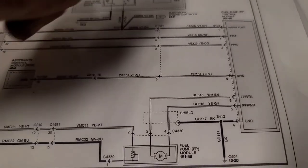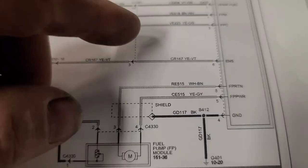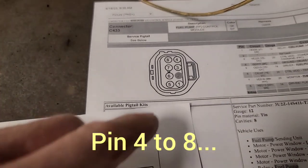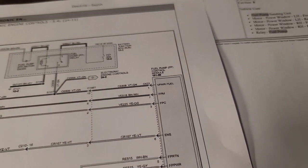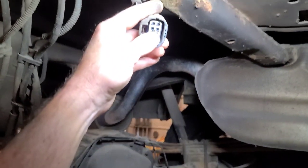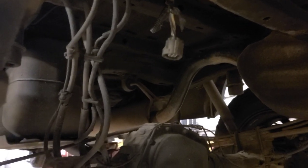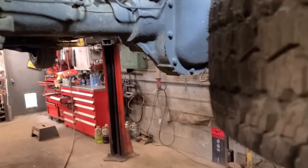To make the fuel pump run, we need to connect pin 1 to pin 5, and pin 4 to pin 8 at the fuel pump driver connector. The old fuel pump drivers let you put a couple of fuses in, but these terminals face the other direction. My trouble light just died — that's why they call them trouble lights. As you can hear, the fuel pump is running in the tank and it sounds nice and smooth. We're going to current-ramp it with a lab scope — just going to let it run for a while.